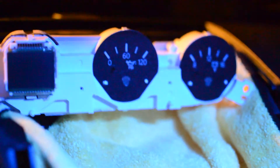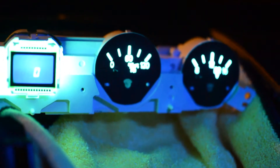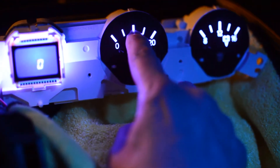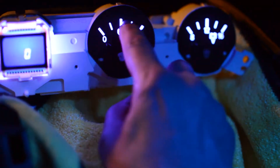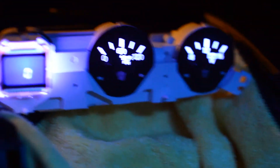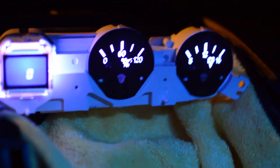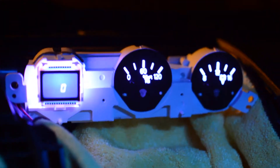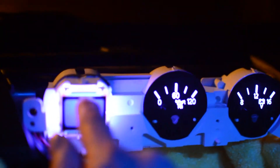That means the two needle lights are in the same circuit as the gauge background lights. The LED I removed on each of those must be in that circuit. The only thing we can do now is break it down, re-solder the LED, and put the RGB on top of it. When I tried to put it back together the LCD wouldn't go in, so I ended up taking the screws loose in the back, fishing around till I found the holes, sticking it in, holding it, and tightening the back. Yeah, live and learn.